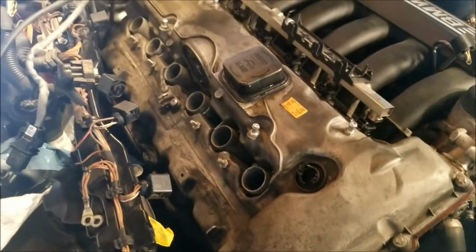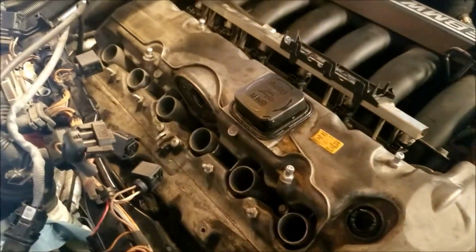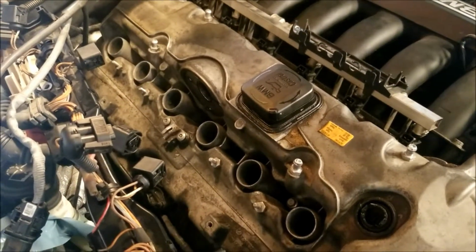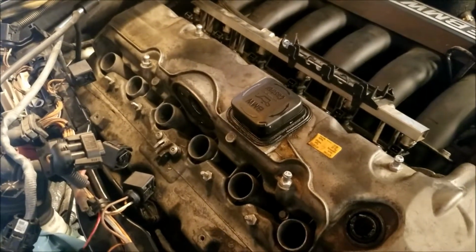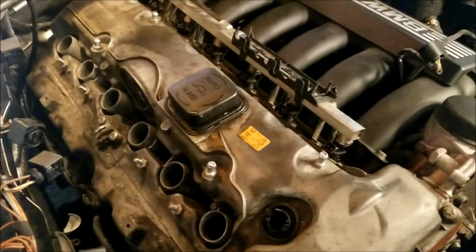Had a good discussion with the BMW guy, and he shed some light on some things. I told him that all 6 of my spark plugs have oil on them, and he said, uh-oh. I go, what? And he said, your oil separator hose is plugged.